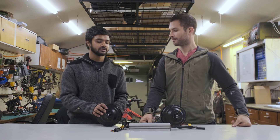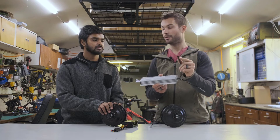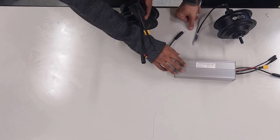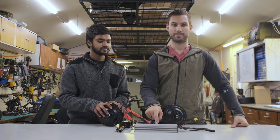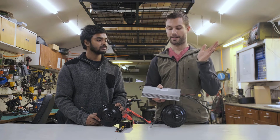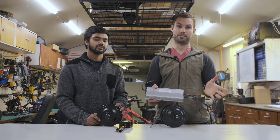These controllers have your motor cable on each side, battery cable, pedal assist, and a handlebar harness. The handlebar harness can run a front light, but only one light. Normally controllers like this have a rear light plug, but this one does not — so you can only run a front light currently. In our next generation we will have this available with a rear brake light option. Also, in our next-generation controllers we'll be getting them to operate between 40 to 75 volts, so they'll support regen braking with higher-voltage setups like 52-volt or even 60-volt batteries.